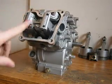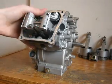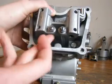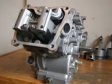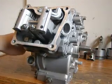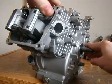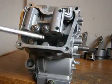So to remove these rocker arms, usually people would loosen up these bolts right there and put slack on the push rods and pull them out that way, but I have a better way. I just rotate the engine so the piston is at the bottom of the cylinder and then I use my thumb to press down — and there goes your first push rod.